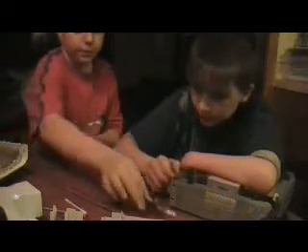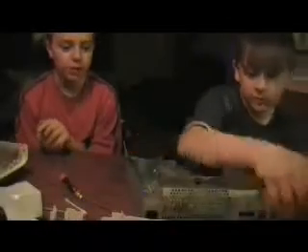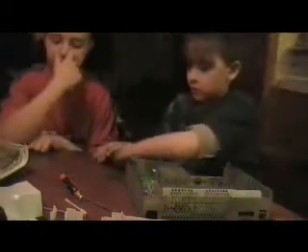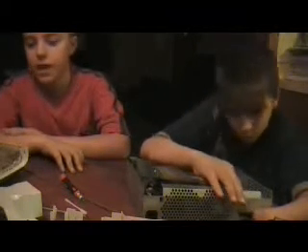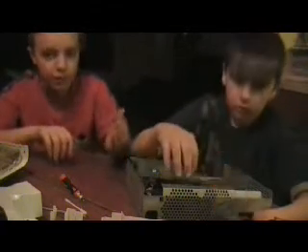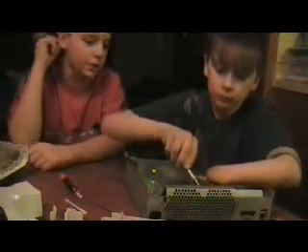And you want to put your four screws that you had in the front back in there. You want to put the fans back in. You've got to put your fan in before you put anything else in. And when we're done, we'll do it live and you can see how well it actually works. This Xbox has problems reading Modern Warfare 2 — you have to open and close the disc tray about a million times. We just cleaned off the lens and cleaned a bunch of junk out of it.